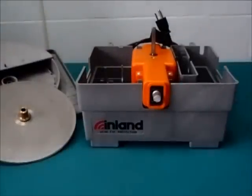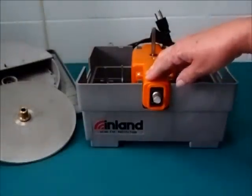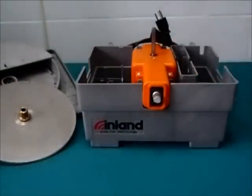Swap Top machines made after 2006 that have the variable speed motor in them also have a 4 amp, 250 volt fuse. If your machine has stopped working, especially suddenly, it's very likely that you've blown this fuse.